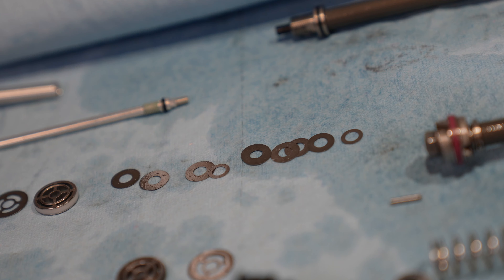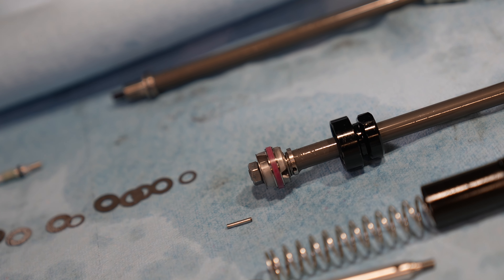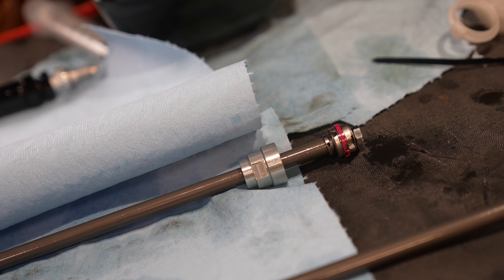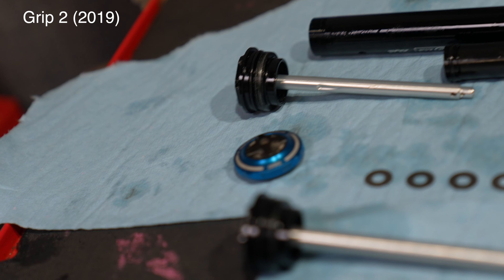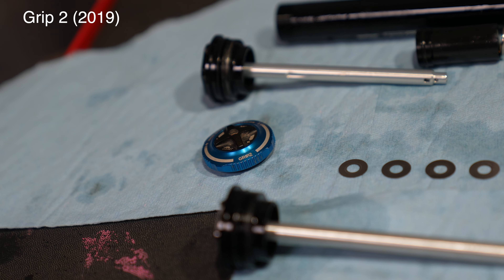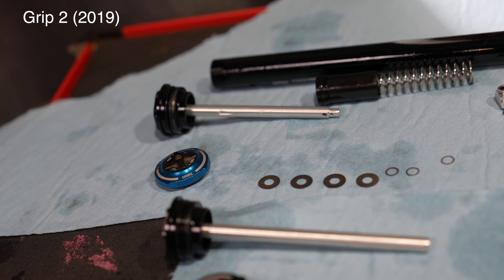From all my experience riding forks, the rebound on the bottom of the fork is not super important — the rebound on the air is just fine. The compression is always what kills the fork. Here they are laid out on the bench: we can see the grip damper has that spring-backed IFP, and the rail damper is virtually identical except it has a whole bunch of extra shims. Both rebound piston rods and assemblies look virtually identical. We can learn here that a good compression assembly is what makes a fork good.